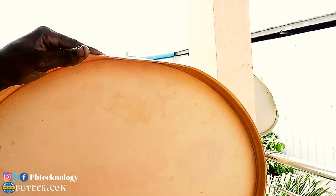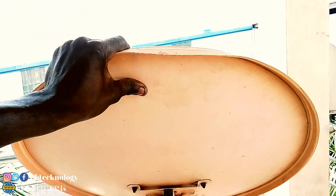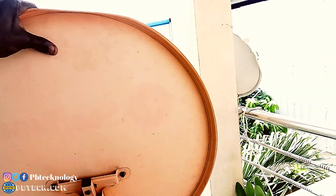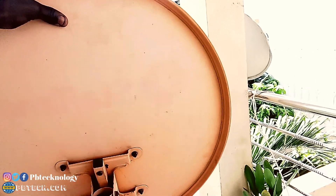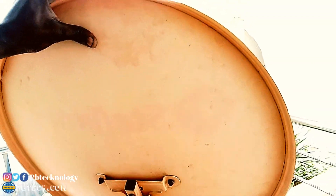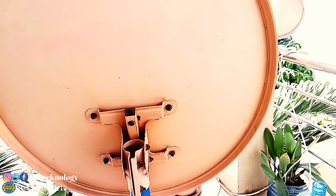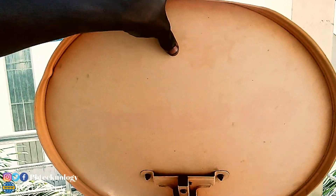Make sure the dish stands firm. Go down, then you go up. If you don't get it, move to a nearby position — don't go too far, just a bit. Then go up and down, then go the other side, up and down. When you see that you are going too far from east, just come back again and go up and down. If it's a bit too loose, you may miss the signal, so it has to be not too tight and not too loose.